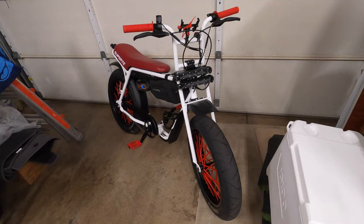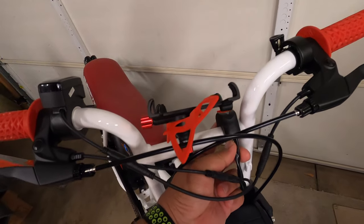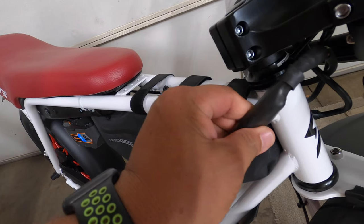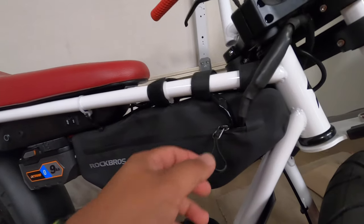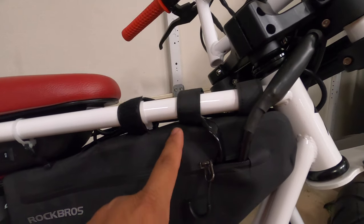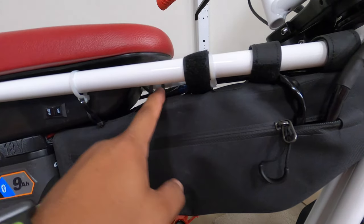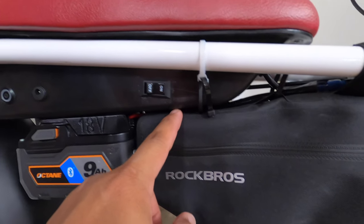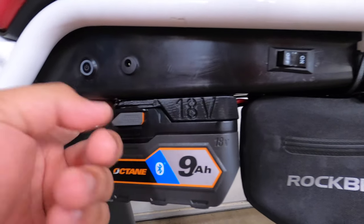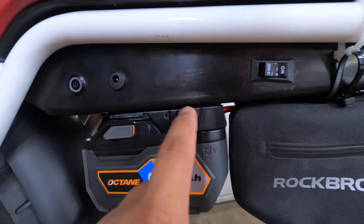Here is the final setup: dual LED bar headlights up front, all wired together along with the switch over here. The wires are bundled together, soldered, and covered in heat shrink loom. I didn't shorten the wiring harness so it's all tucked in there for convenience. It runs in between the frame's top bars and under through the bag. The battery attaches to the seat — it's pretty snug with two screws and a lot of two-way tape. I'll see how that holds up and may add epoxy or more screws using the six holes in the adapter.